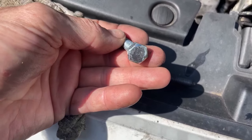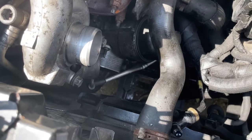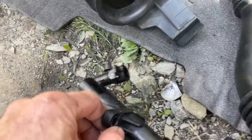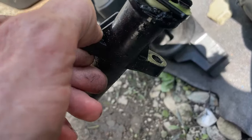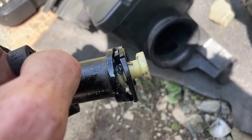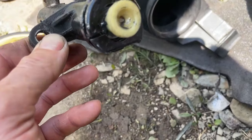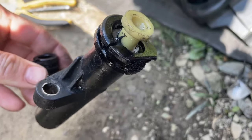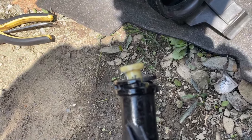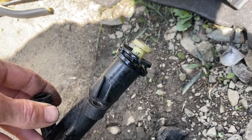I'm in luck — I actually got a spare bolt. What had happened: the bolt had fallen out, and then it had twisted and hit the clutch plate at an angle — you can see how it's bent there — and then it snapped. So my thinking is it spun and wasn't hitting it right and spent itself all out of shape. That's probably why it's stuck in there, maybe because of the pressure as well. But anyway, that's gone. And silly me — I got the wrong part, totally different profile.